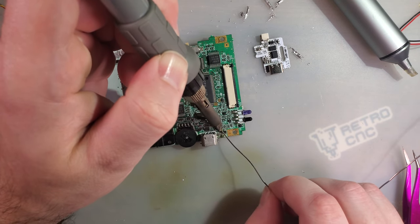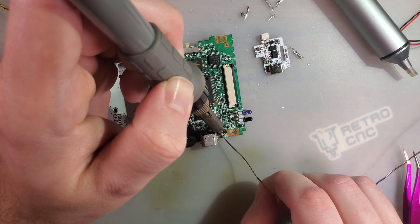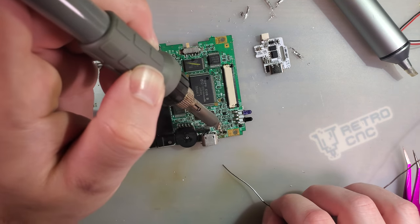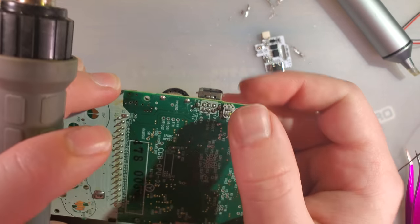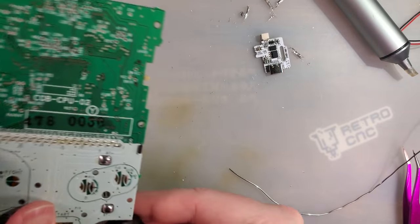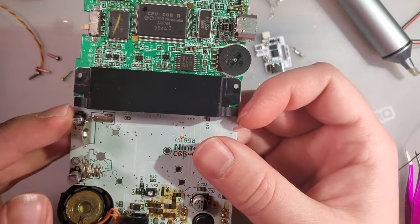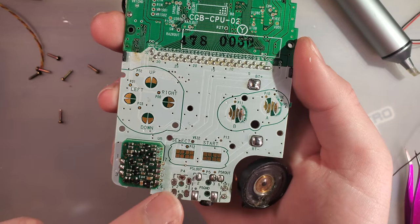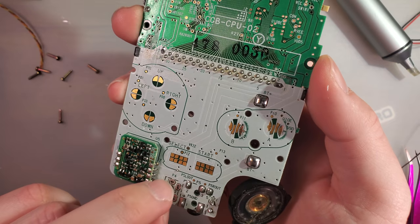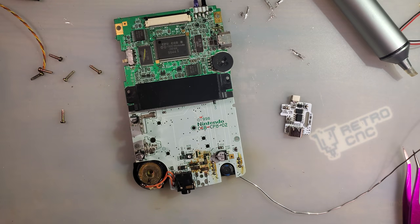I am going to touch it up one side at a time. It looks like I have actually had the battery tabs off this one before — probably water damage based off the scratches, but I think we'll be okay. I am going to clean up all this flux because we won't be able to clean it up once it is assembled. Cotton swab and isopropyl alcohol.